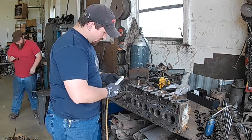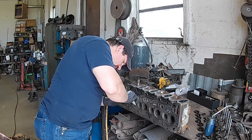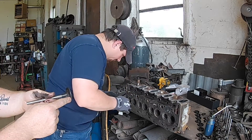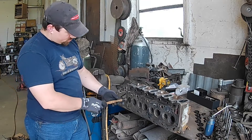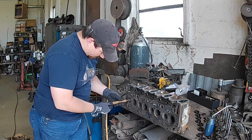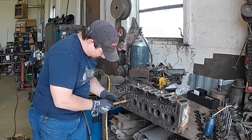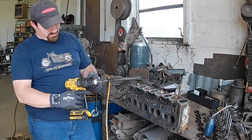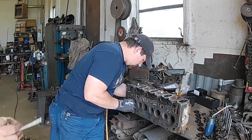Put a little oil on the valve stem there, and I have some valve grinding compound. I put a little valve grinding compound right around where the seat is up there — really don't have to be much anywhere else. Then it's an old school valve grinding suction cup, and you can sit here and do that right there. Make sure the compound gets all the way around it. You can sit there and do that and check every little bit and see how your valve's looking.